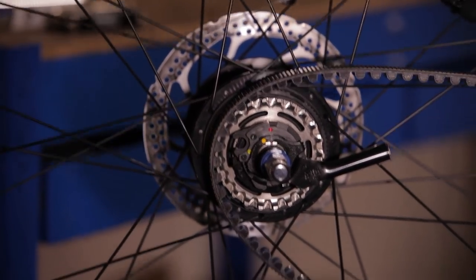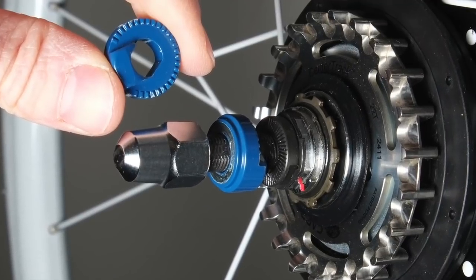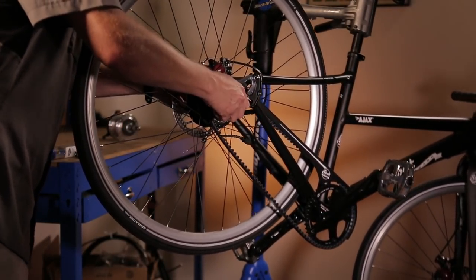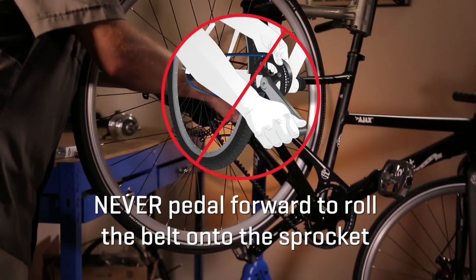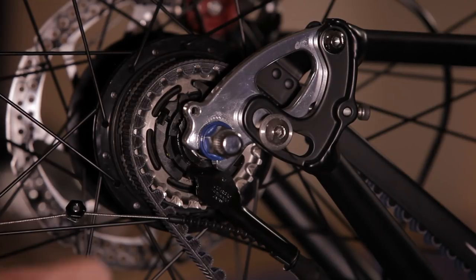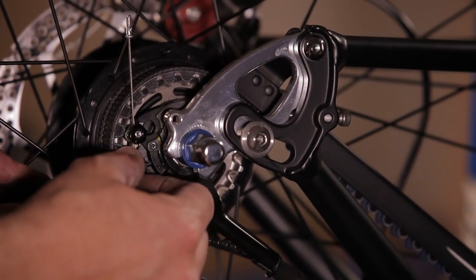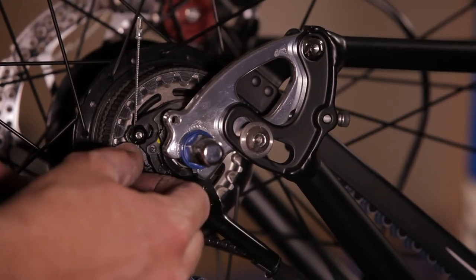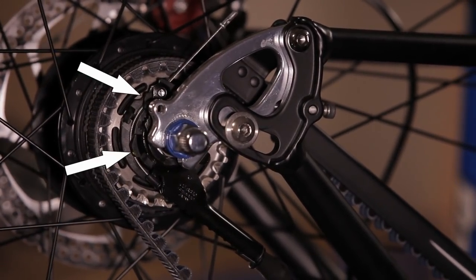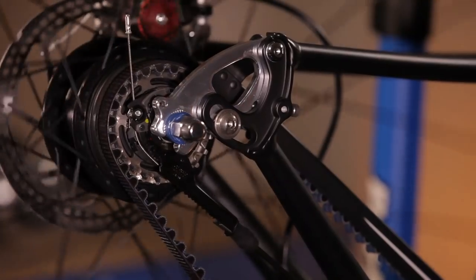To reassemble the bike, secure the belt on the front and rear sprockets. Note that wheels with internally geared hubs require no-turn washers, which can only fit into the dropouts in one direction. Then return the wheel, with the belt in place, to the dropouts. Never pedal forward to roll the belt onto the sprocket. Make sure the axle is fully seated in both dropouts and the axle nuts are securely tightened. Rerun the cable into the cassette joint by inserting the 2mm hex into the hole. Note that the nut that engages the cassette joint is shaped to only fit in one way — start from the bottom and slide the flat part of the nut into the cassette joint, ensuring the cable is routed properly. With the rear wheel still elevated, pedal through the gears to make sure you are able to shift properly.